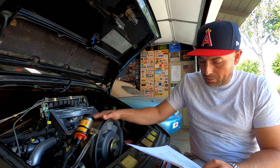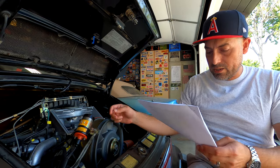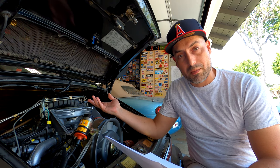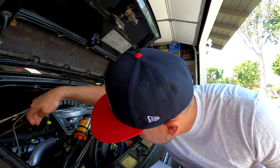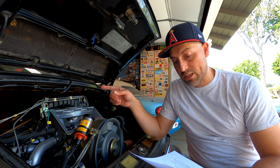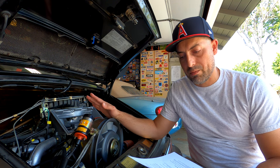If you have lambda like this car does, you have to unplug the O2 sensor wire in the engine compartment so that it disables the lambda circuit and it doesn't mess with your fuel mixture as you're trying to tune it. Next, start the car, let the oil warm up to normal operating temperature, then set the idle to around 950 RPM using the big screw on the side of the throttle body. Keep an eye on your oil temperature gauge during this process to make sure that it doesn't get warmer than normal operating temperature, just in case the car is running a little bit lean.